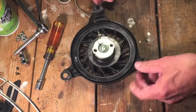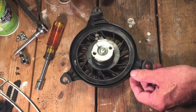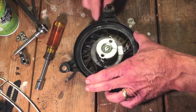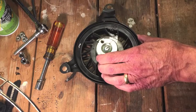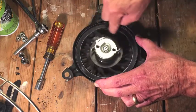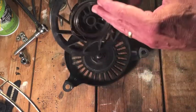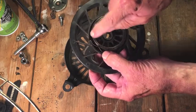With the recoil assembly — or starter assembly, whatever you want to call it — it has lost its tension. The question is why. Inside, either the spring or the metal band has broken or lost its anchor point. I'm getting the rope off; tension should be building inside on that spring, but when I release it, it does not spin back. The spring is not broken — it has lost its anchor point.